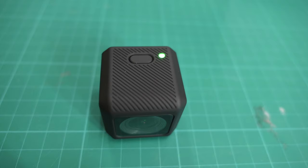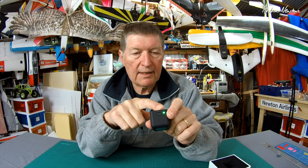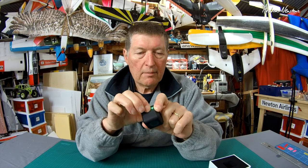So if there's no Wi-Fi, how do you set it up? You use your smartphone, download the SJ Cam app, set up all the parameters on the phone, it generates a QR code — one of those dotty codes — and you just put the camera into setup mode, hold the QR code in front of the camera, it takes a shot and loads all the settings. It sounds kind of weird and old-school but it works really really well. On the top we get the one button and a little indicator LED. Push and hold to turn it on, you get the green LED. Push quickly twice and you put it into setup mode, which goes to blue light.